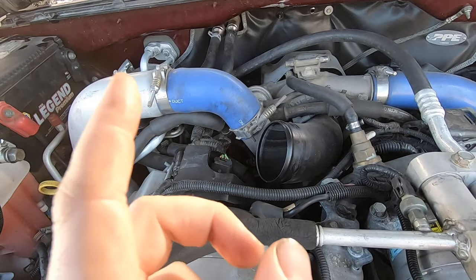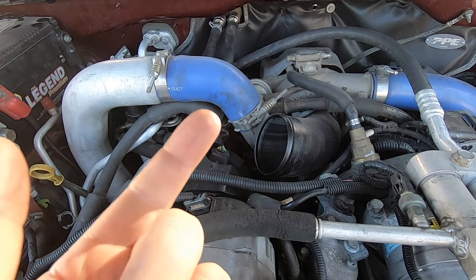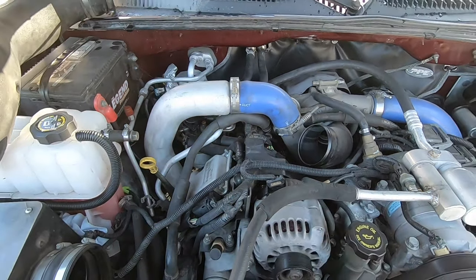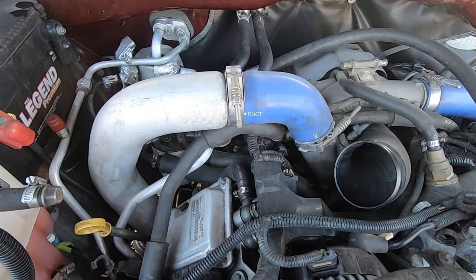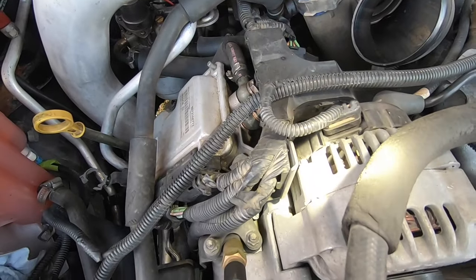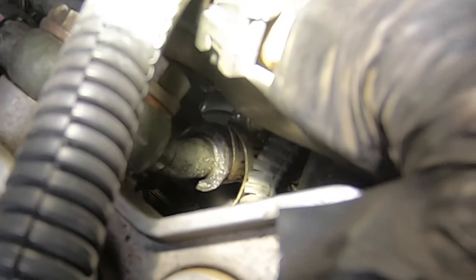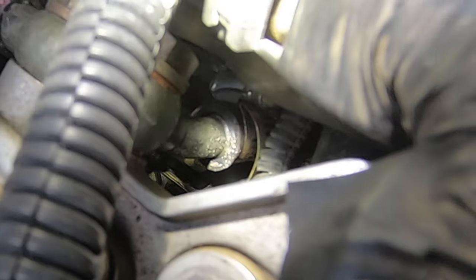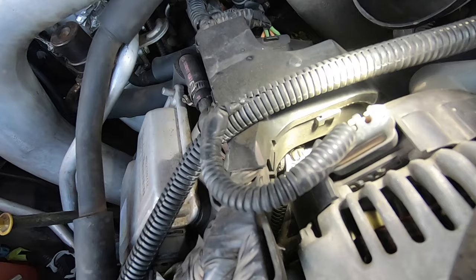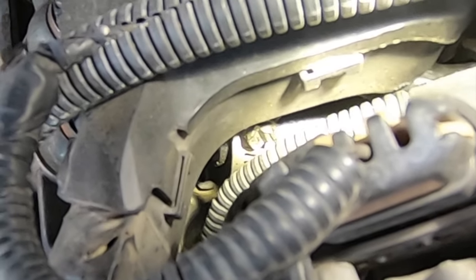The interesting thing is I don't have a fuel leak. We have something that is allowing air to draw in but not allowing fuel to come out, which makes troubleshooting a little more difficult. But I'm hoping we can find at least a wet connection or something that indicates a leak. I've got my eyes on a suspect here — very hard to see, but that looks wet to me. That hose looks in kind of crappy shape, and looking through the side here I see wetness on the outside of the hose by the clamp as well.